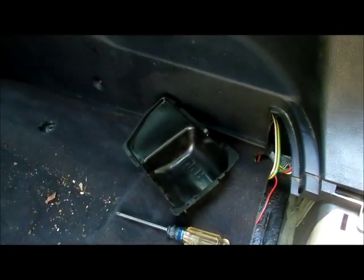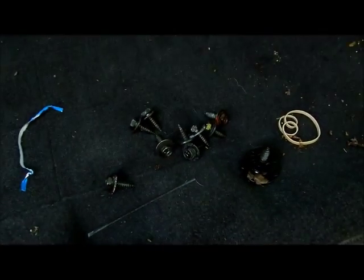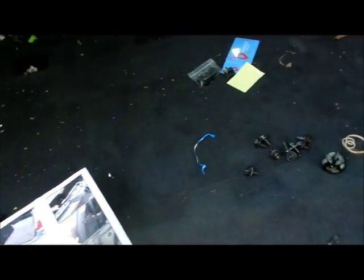This is the area where I spliced and put the tape. I took two zip ties - used white so you could see them - one on each side. You want to be right on the last bit of the tape on both sides so it doesn't unravel. Go ahead and snip off the pigtails - the tags. Use a pair of dikes or a pair of scissors to do that, and be careful not to cut the wires. Doesn't look too shabby as far as cleaning goes. That's just one strip using a shop vac - just working it in, scrubbing back and forth. I'm going to close this one up entirely after cleaning it. Make sure the connectors are really good.